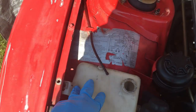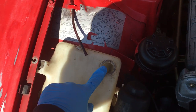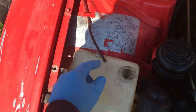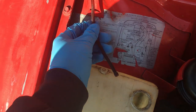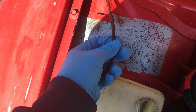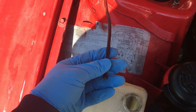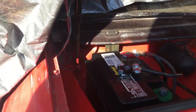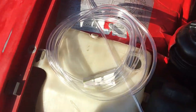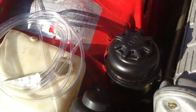Today I'm going to be replacing this washer tank since it has a hole in it. I've got one from a parts car that I'm going to be installing. I also have a brand new cap and new fittings that's going to go on here. And if you look over here, you can see that the early car has used a clear tube, but this one has seen better days. So what I'm going to do is take this out and just use it as a sample to go get some new clear line. I removed all the old tubing and replaced it, so you can see I've got an all-new line running down here to the reservoir. And this is how it's supposed to look — it's hard to believe that this tubing once looked like that.